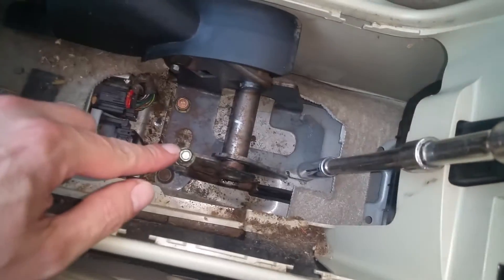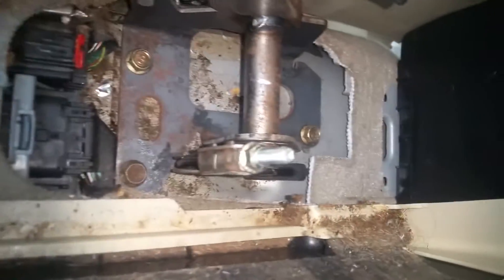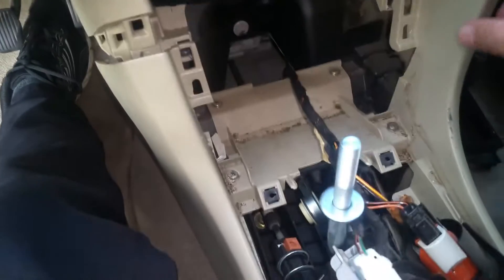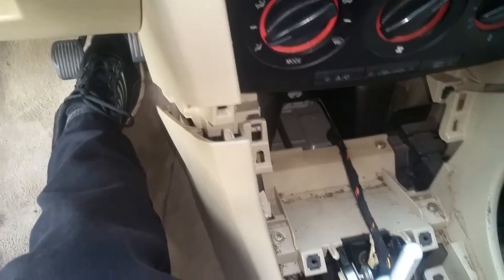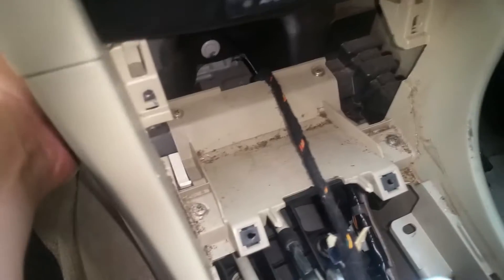Since they're the same, it'll work. I'm tightening the three 12-millimeter bolts down and then tightening the cable nut back to 14 threads using the 10-millimeter. Now I'm working on setting the console back into place — it's pretty simple. There are pins up here that have to realign, and then just like that it snaps in on the sides.